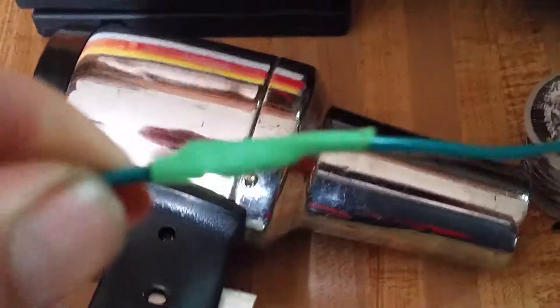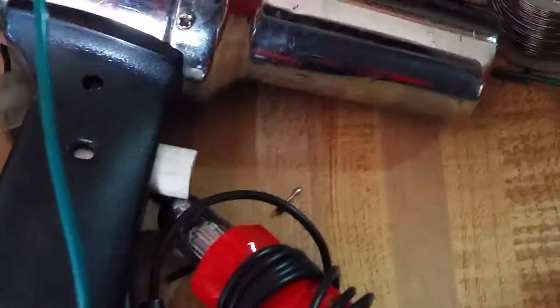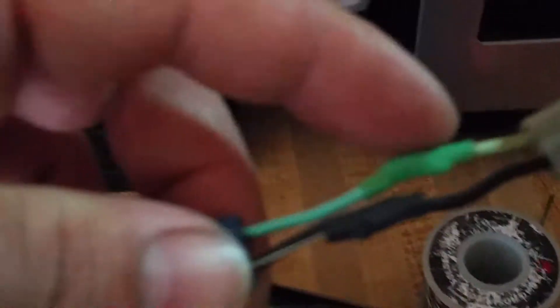When you're done, this is what it will look like right here. Hopefully that helps. I do apologize for the quality of this video. That right there is what it looks like — that is the twist-and-bend method that I use. You can see I bent one wire one way, soldered it, and bent the other one the opposite way.